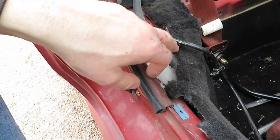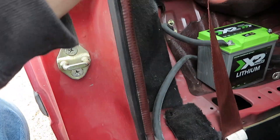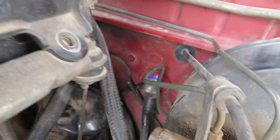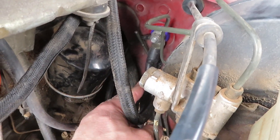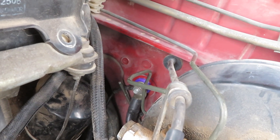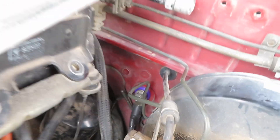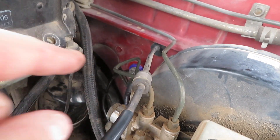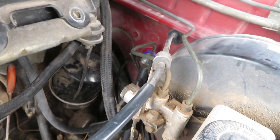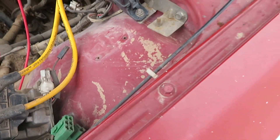Then you put that piece of trim back — it's like a piece of compressed cardboard. I'm actually going to remake mine out of carbon fiber because I broke one pulling the clips. The cable comes up and it's all hidden behind everything, going right to the battery. I loomed and fixed some wiring issues, and we have the firewall connector for the battery cable going through the spot where the speedo cable usually comes out. I'm probably going to end up doing GPS gauges since my gauge cluster is kind of iffy. The battery cable goes down to the starter, comes up to the alternator, and also comes over to this little fuse panel here because it still needs power. I'm going to run my fans off this fuse panel too.